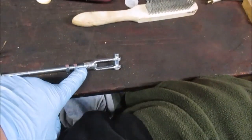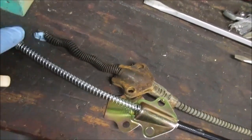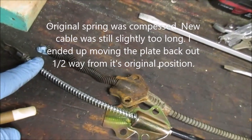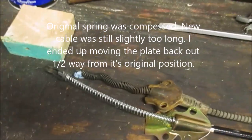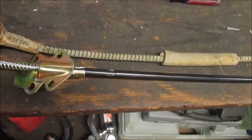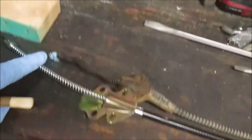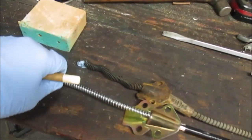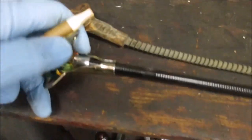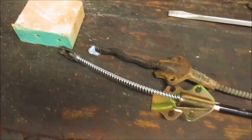Here's my aftermarket new brake cable. I wasn't sure if the old adjuster end would bolt onto it, but looking at the lengths — see how much longer this plate is — that's a good half inch to maybe not quite a half inch difference. I loosened this clamp, which was all the way down here, and moved it all the way up as far as it would go. It bottoms out right there on that steel end. Hopefully that won't stop me from being able to use it.